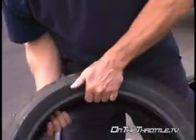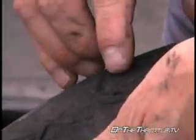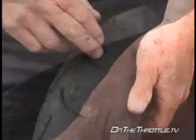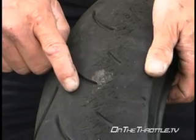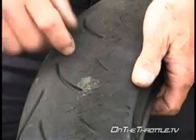This one was another hot tear, but it started as a cold tear. So the pressure was just shy, so you could dig into the tire. Right. But then as the day went on, it took out some of that and then was too low and turned into a hot tear. So this tire went from being overinflated to underinflated during one day.